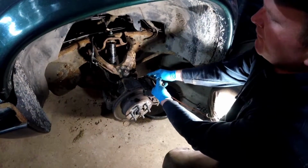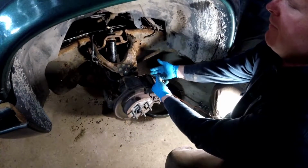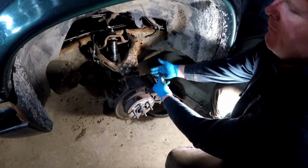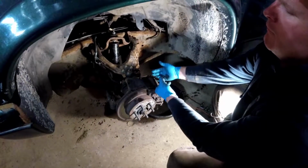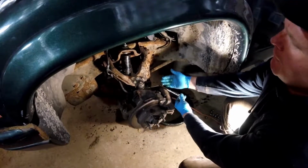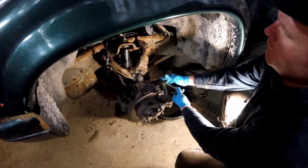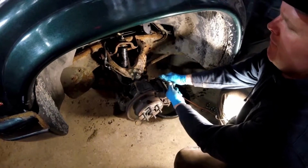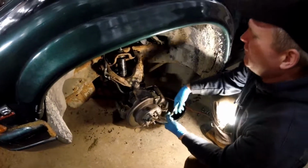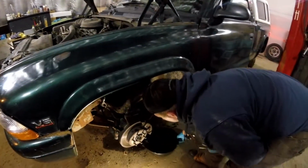You down? Mm-hmm. Are you hearing that? No, I didn't see it. Yeah. Up. Down. Looks pretty good now. One more. Up. Down. Looks like a solid stream. Up. Down. That looks pretty good. Okay, I'm going to go around once more. Now you got a good pedal, right? Chad? Up now, yeah. I'm just going down once more because now he's got a good solid pedal. And I can definitely make sure to fill up that reservoir down there.